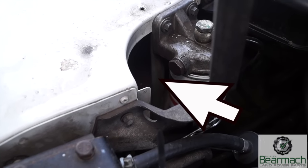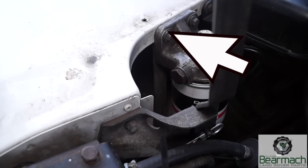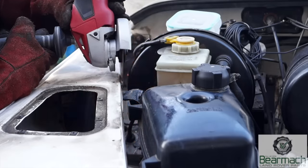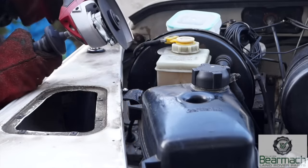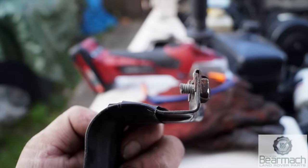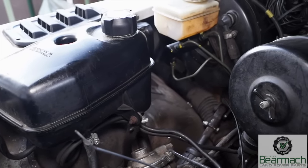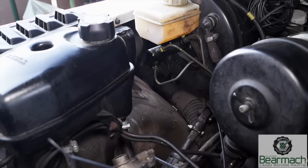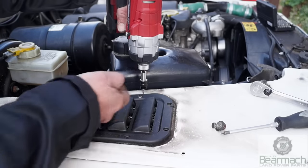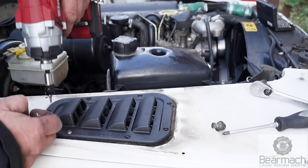Behind the filter you have a sneaky bracket here. It's bolted to the inner wing and also provides a riv nut for the fuel filter bolt. What I'll show you here is that we actually wound the bolt out so we had some of the shank before we cut it, which makes it much easier to cut - taking the head off is a lot more work. Now you can see this is easy to do. For the header tank, I'd advise not using an angle grinder because even if you can cut the nut you'll probably melt some of the header tank through the heat and friction of cutting. Using a power driver to remove the panel screws is very easy; just be aware when screwing it back in it's better to finish by hand so you don't crack it.